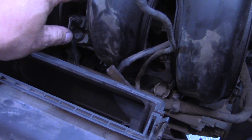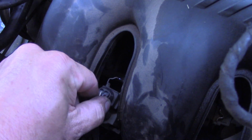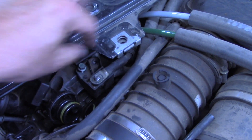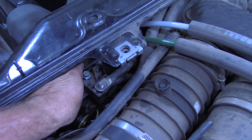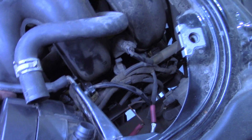The first thing that did not have to be disconnected was this connection right here in between cylinders four and five. It comes out with the wiring harness, so it does not need to be removed. The next one is taking out the two bolts that hold down the B-plus box in the engine — that can just stay in place. Do disconnect the ground wire right there.